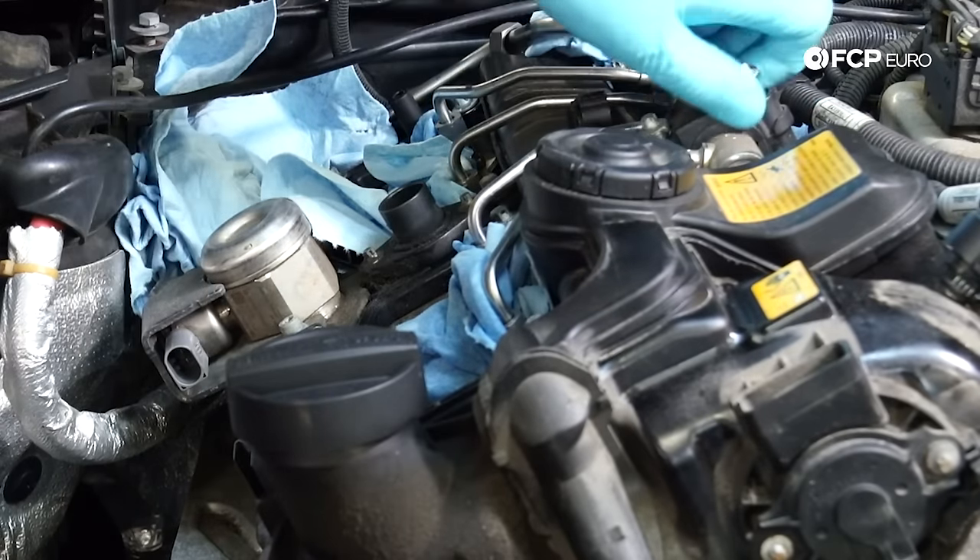The new module includes the tensioner, the guides, the oil pump drive sprocket, and the crankshaft drive sprocket for the oil pump — the entire unit replaced as one piece. It's pretty easy to do if you're doing the timing chain — these are the kinds of things that if you're doing one it absolutely makes sense to do the other. Both jobs independently are a lot of work. Another thing to look at: the plastic guides have become brittle and started to fail over the years. This car is seven years old, 135,000 miles, and you can see little chunks broken off the guides. Oil soaks into the plastic, plastic becomes more brittle through heat cycles.